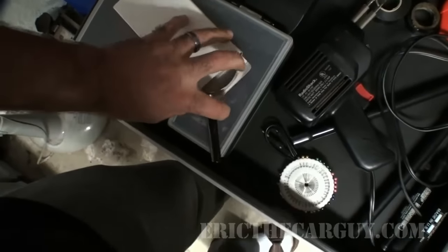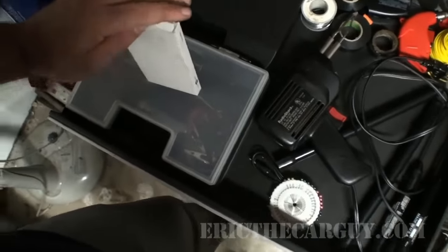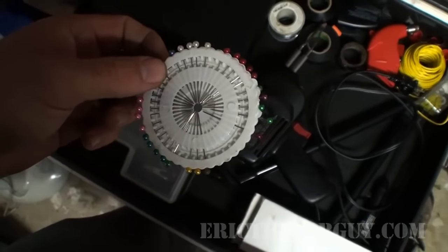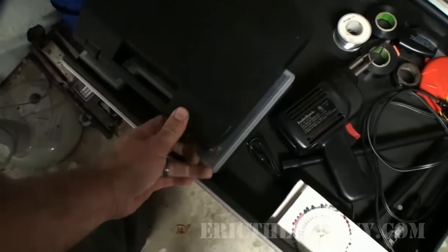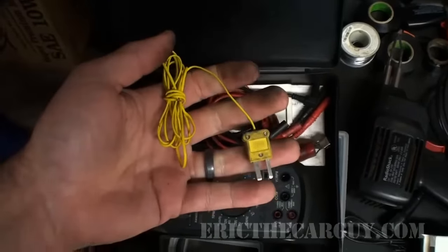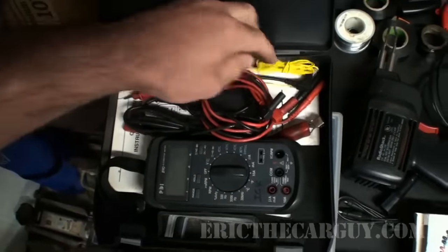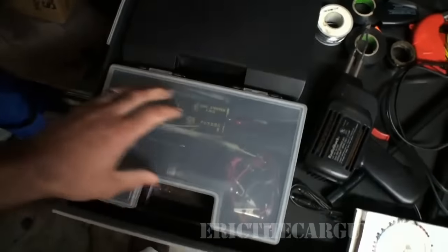Magnifying glass — kids love to take that and play with it, not for burning ants, they like to see things big. I used to burn ants with it. Stick pins — I use them to back probe connectors. I stick them in the back of a connector to take some measurements. This is the first DVOM that I had, and it works great — I've had this thing since I was in auto mechanic school. What's really neat about this one is that it's got a temperature probe, so you can take temperatures. If you suspect a catalytic converter problem, take its temperature at the front and the back — it should be 100 degrees hotter at the outlet than at the inlet. If it's not, it's not doing its job.